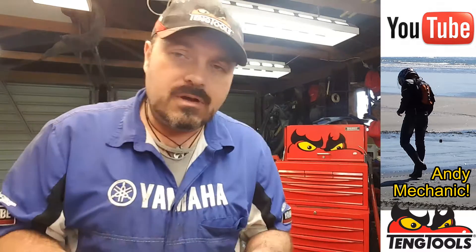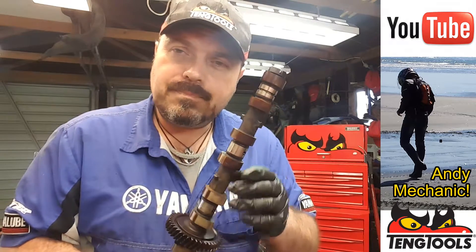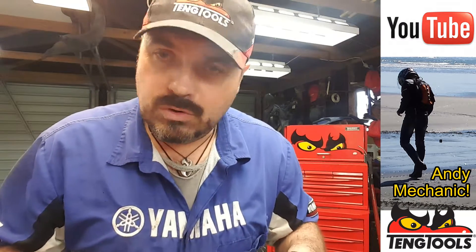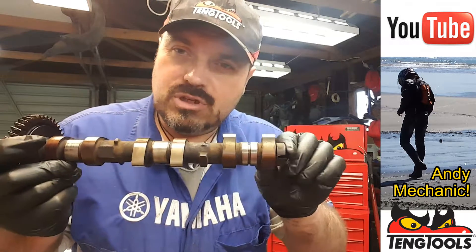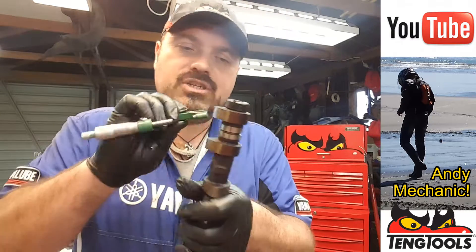In this particular video — a very short video, little bite-sized chunks — I'm going to show you how to measure the camshaft journals for wear and condition. You can have a look and see for yourself if it's scored and things. But as these things wear, they're going to reduce in diameter. So you'll need, ideally, a micrometer that's the right size. We're going to measure across that journal. Let me show you how to do that.